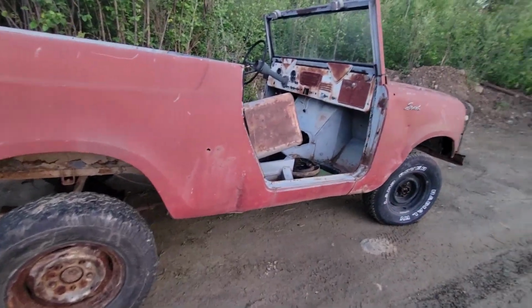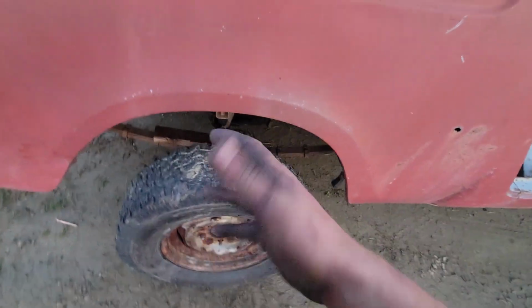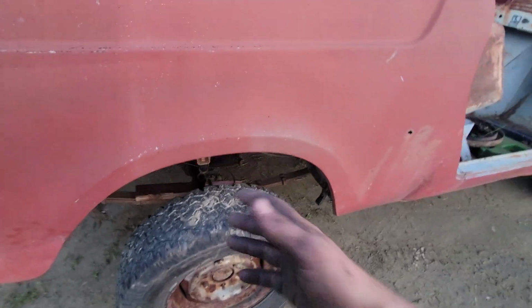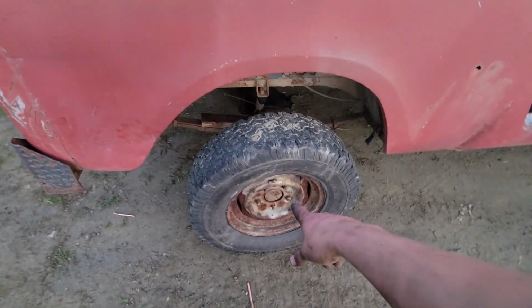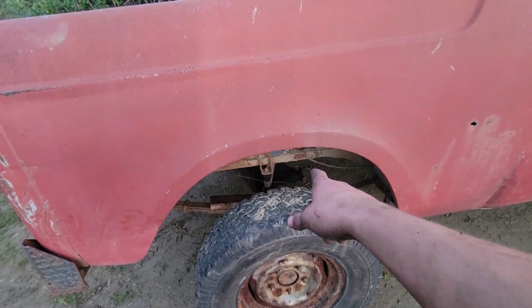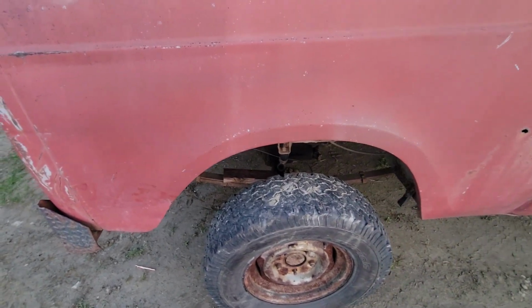Alrighty, we're in the big money now. We got a rear axle under this thing, and I did a real top-notch spring over axle upgrade on this thing. Oh yeah, this is my new wheeling rig, you know, she's mint. Now, in all seriousness, this is an old Dana 44. This came out of my step side. The pinion's sloppier than I'll get out on this thing, so obviously it leaks gear oil and whatnot, but it'll roll, and that's all this Scout needs to do.